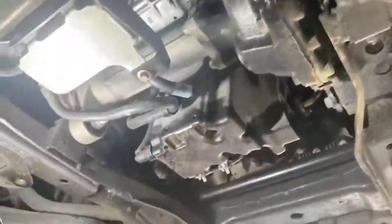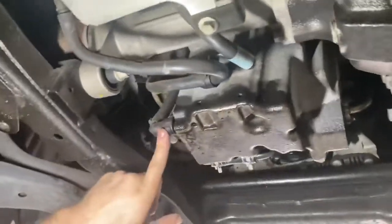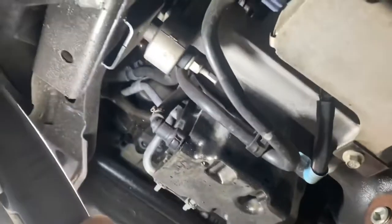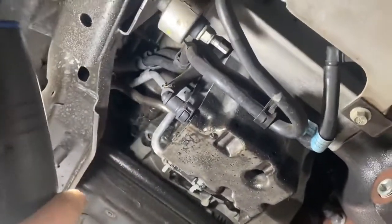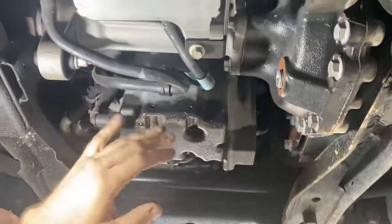Come under here — you can see once you pull the undertray off, there's obviously a bit of oil here. At first glance it appears to be this that's leaking, but that's not the case. If you come up the side here, the oil tends to start from the upper sump and come down behind the starter motor. To replace this there's a gasket you get from Land Rover — this being the sump, not this pipe.